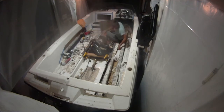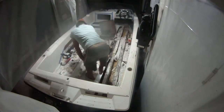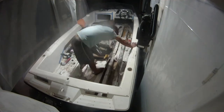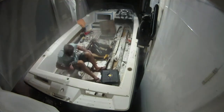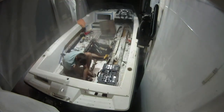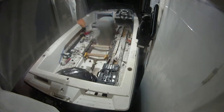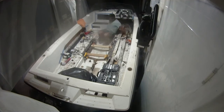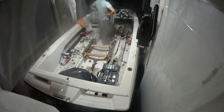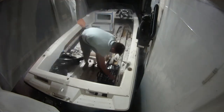At this point I've got most of the foam ripped out of the exposed section. Now I'm trying to get a look up into the nose of the boat to see what's going on under there. It appears there's a big blob of flotation foam up in there with the bottom four inches looking black, which means wet. So I'm going to have to address that later. But first I'm really going to tackle this steering cable, which I should have gotten to a long time ago. I decided to take it out from the rear, which I did successfully — got it out through the battery box. I did try to get the steering cable out from the steering wheel portion, but that did not go well. I'll have to deal with that later.